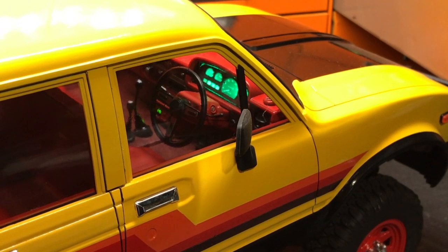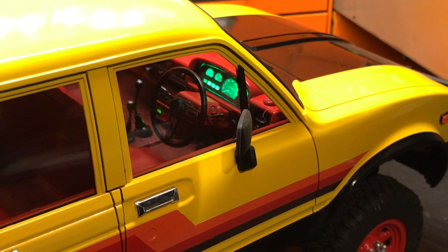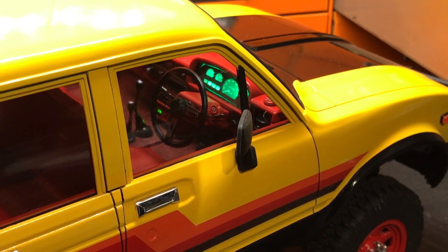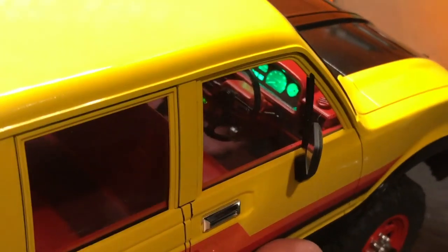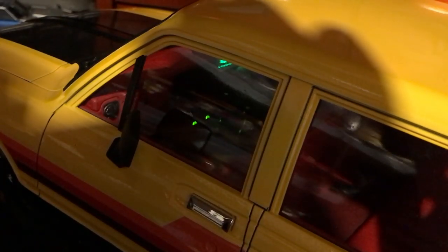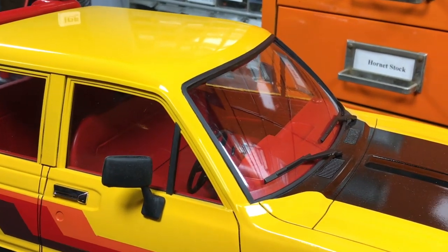I have to say I made one glaring error — when I put the lens in I should have painted the perimeter with a matte black paint, because the light bleed around the edge of the aluminum trim plate is nothing more than the lens behaving like a light pipe. Please do not do this on your vehicle because it is too late for mine. As for the auxiliary gauges, those look really good. In person the perimeter bleed is really not that noticeable — the camera exposure makes it look much worse than it actually is. And with that, our interior set is complete.